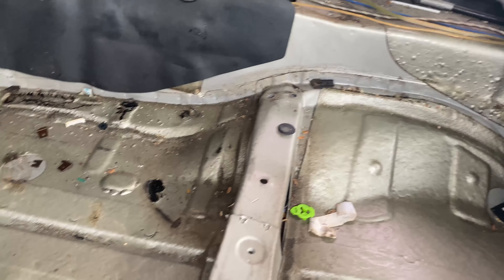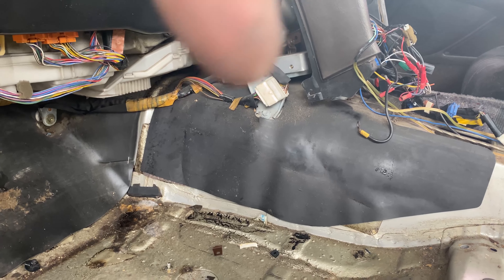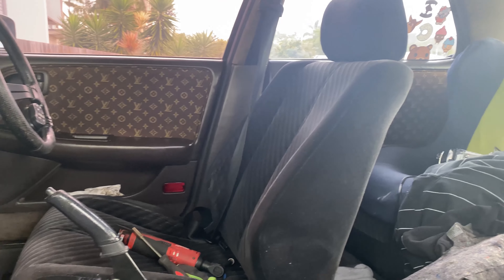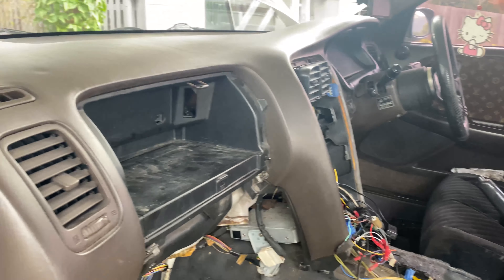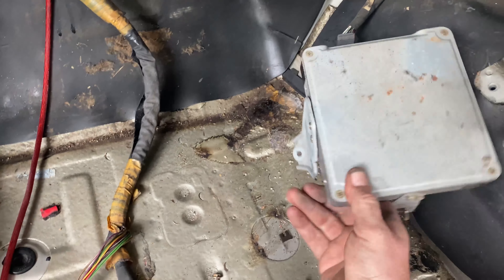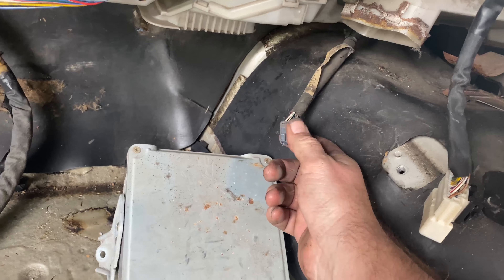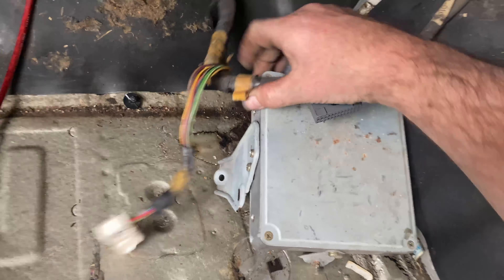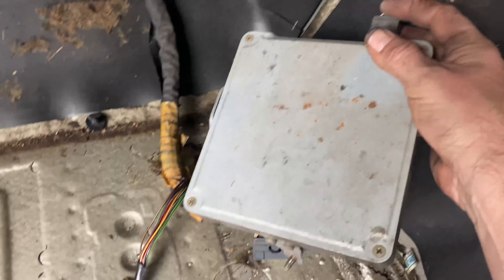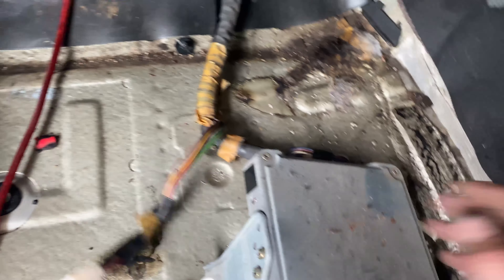So I just pulled up the carpet — you pull out a strip and then the carpet unclips under these clips. There's our little guy that we want, and I think that's our wiring. This car has all sorts of different interior — there's some Louis Vuitton, it's a JZX100, the dash is brown but the carpet's grey, meaning it's been changed in the past. The ECU sits up in there, and this plug here — we'll find out where it goes later. The grey ones go in the back of the ECU: one goes to the rest of the car, the others go to the engine.